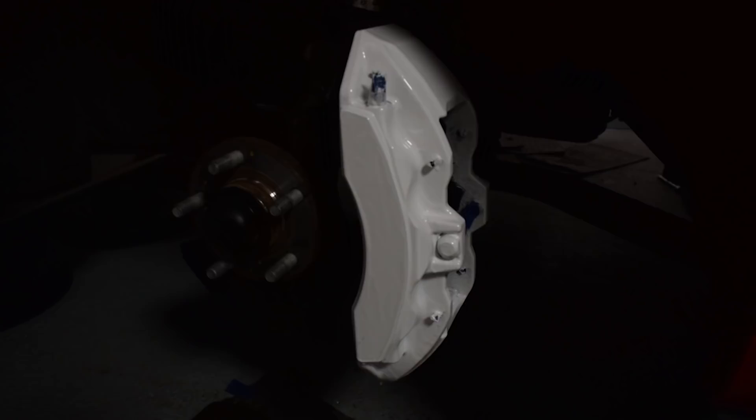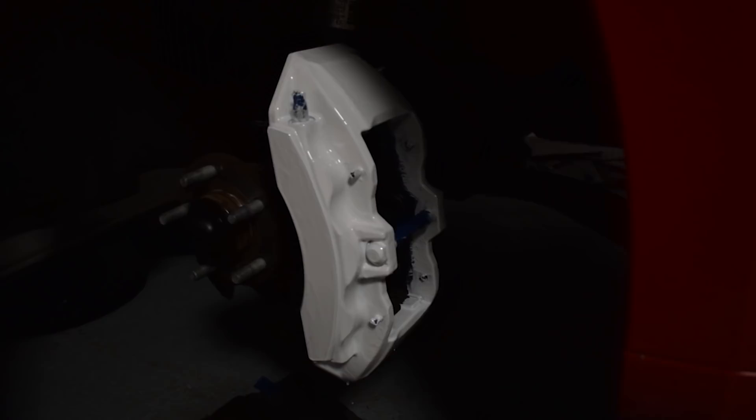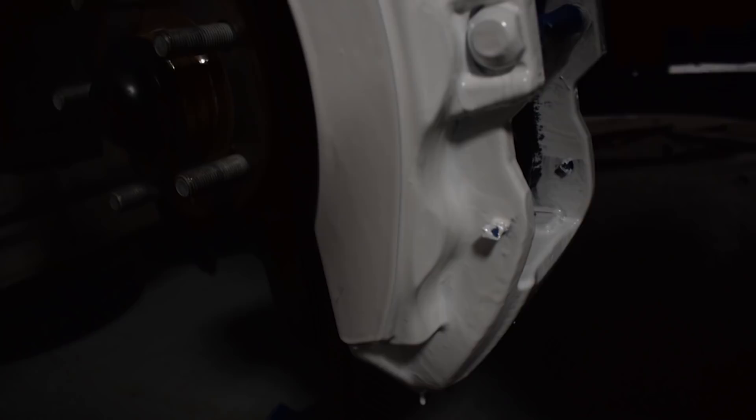I think I'm ready to call it a night. The trouble is with this stuff, you never know when to stop — you just keep going at it and it ends up making it worse. But it's levelling quite well; there's a couple of little runs where I've put too much on. Probably the world's worst idea, painting brake calipers white — they're not going to stay that white for long, but I could steam clean them every so often. I still don't know whether it needs another coat. Look at that run. The trouble is it's going off, so the more I try and add to it, the more it's pulling and dragging along.